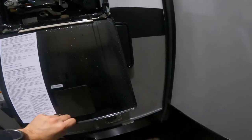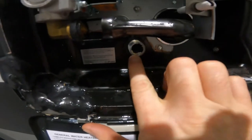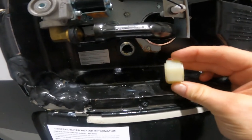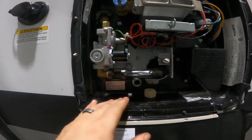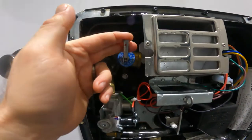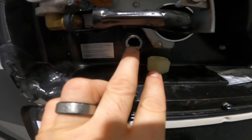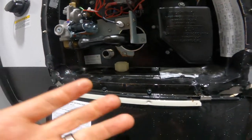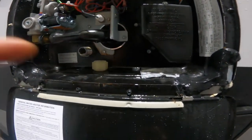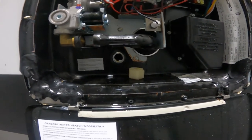Here is the outside access to your hot water tank. A couple of things to note: your drain and the drain cap, as well as your pressure relief valve. It's important to always relieve the pressure and leave the valve open while you're attempting to remove the drain plug, otherwise there's a lot of pressure built up inside the tank that will force this cap off once you get to the end of the threads. It will come shooting off at you pretty hard.